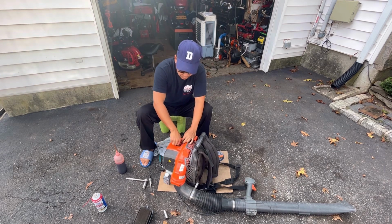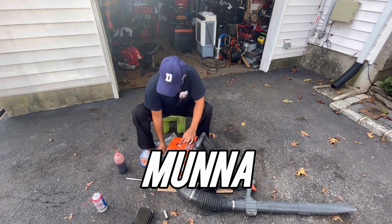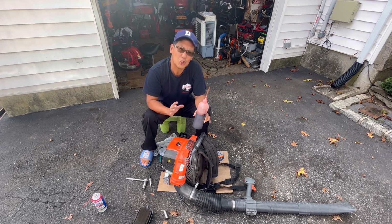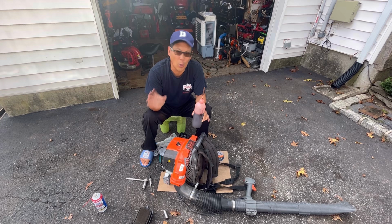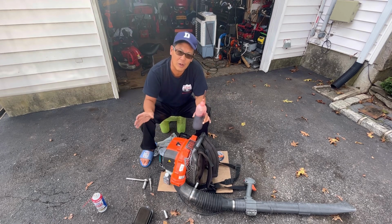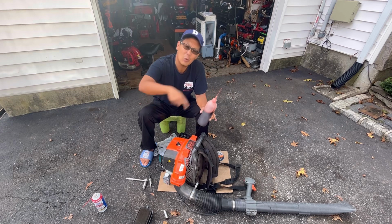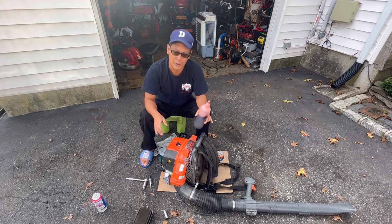But what I'm gonna do, I'm gonna pour some ATF in here. No, not alcohol, tobacco, and firearms, but your regular automatic transmission fluid, because ATF is like a detergent. In the olden days, when people were ready to give their truck or car an oil change, they would put a quart of ATF mixed in with their 4 or 5 quart engine oil and run it for like 25, 50 miles, something like that. Then they would go get an oil change, and basically the detergent would clear out all the sludge that's in your engine and let it drain out, make it run cleaner.